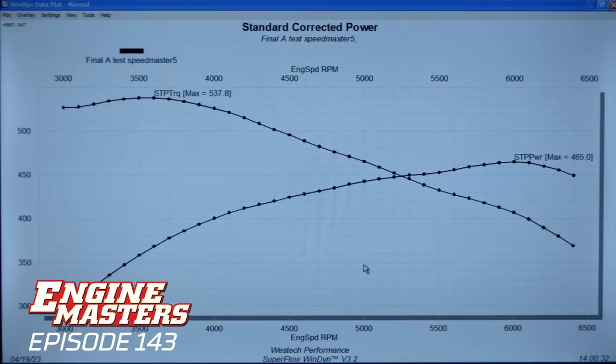The horsepower seems kind of low for that tall of an RPM peak. It's kind of one horsepower per cubic inch. I guess so. It's 8-to-1. It is what it is, I guess. Yeah, it doesn't mean that we can't compare the different intake manifolds, in my opinion.